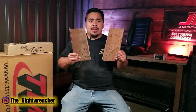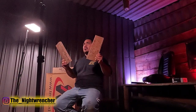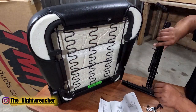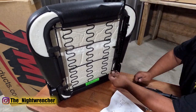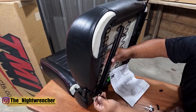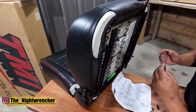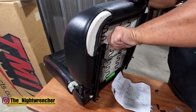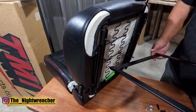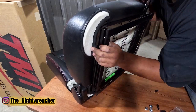Regardless, I made a set of these mounts, two for each side. The only problem I had with these is that while I was driving out to Vegas, I realized they were a little too low, so I made a second set that are currently on my truck that put the seat about two or three inches higher. The installation was fairly quick — it took me about 45 minutes to an hour per seat, and that was including the fabrication of my seat brackets. So if you're able to buy a bolt-in kit for your vehicle — like the one for my Dodge truck that's now available — it probably wouldn't take nearly that long.